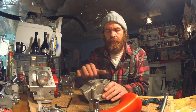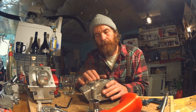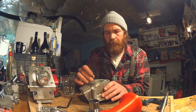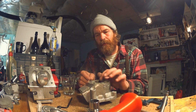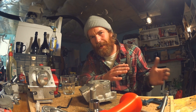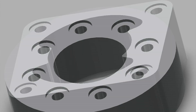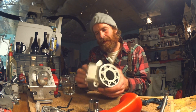Daniel Hudok sent me a mail talking about bore distortion from the head bolts. I must admit I'm not the most experienced in that kind of stuff, but he explained that the short tiny bolts here couldn't do much damage — or so I thought. He told me that short bolts are the worst, and my short bolts are located exactly where the ring needs to seal, so that might be a problem. Forrest Carroll kindly offered to make me some pressure plates I can use while honing after plating, so the bore can become true with bolts torqued to spec. Awesome.